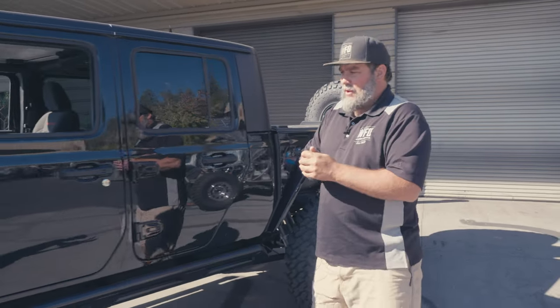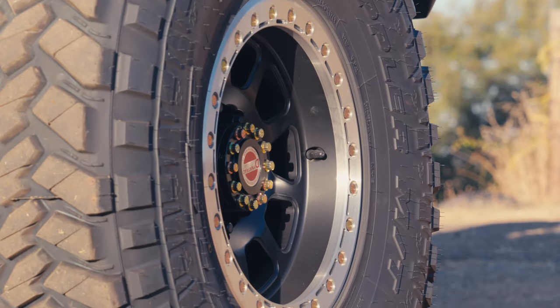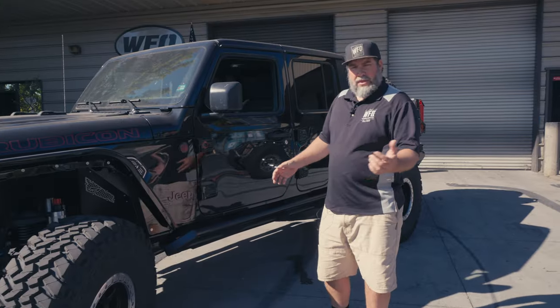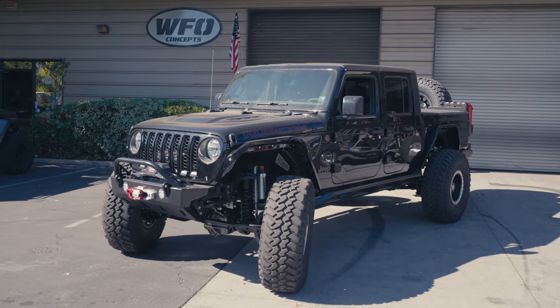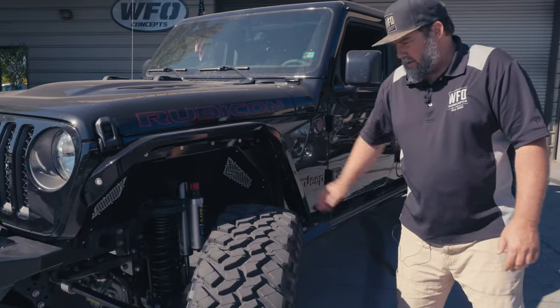One of the things he wanted to confirm is that this was the end-all, do-everything vehicle. So some of the things he went with: these Battle Born wheels — 17-inch forged wheels — and 40-inch Nitto Trail Grapplers. One thing that's a little different on this one is we did MotoBuilt front fenders, MotoBuilt inner fenders, and then color-match painted the fenders themselves and powder coated the inners.